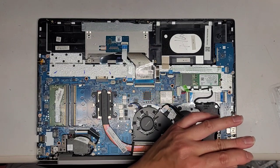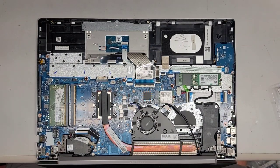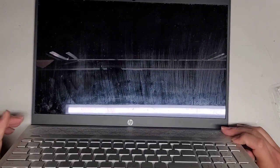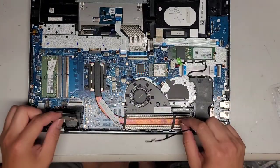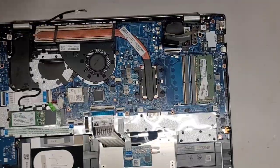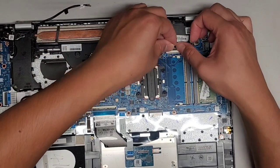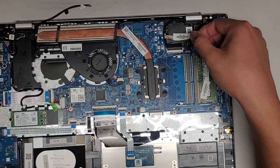Sometimes with these designs I don't really like to put thread locker because when the plastic breaks that holds those things in place, it's nearly impossible to get out after that. Now that we've got the screws for the hinges tightened in, I'm going to rest it on its back and use my thumbs pressing on the hinge area to help turn it to close — just like that. You can see it works perfectly.